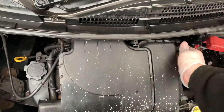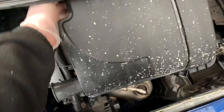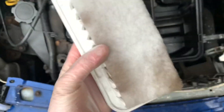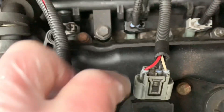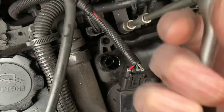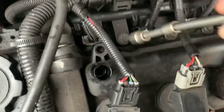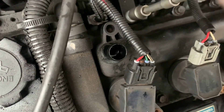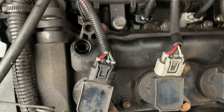So that's the one litre beast and we want to change the injectors. To do that we've got to take off the airbox first, which is quite awkward. That's the air filter - quite new - we'll put that somewhere safe. The injectors are lovely and clean because I've already cleaned them. You've got to take out the 12mm bolts and then move the fuel rail up, unplug it, and they just pull out.